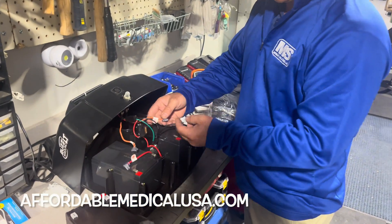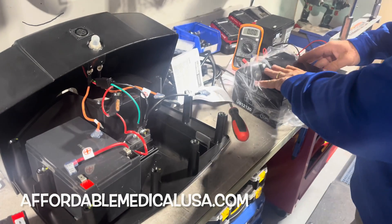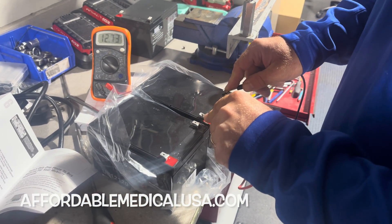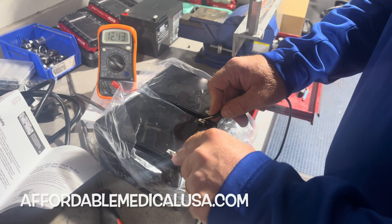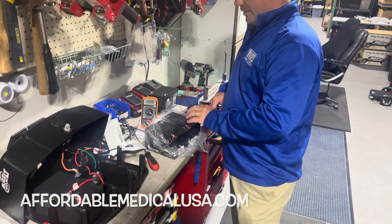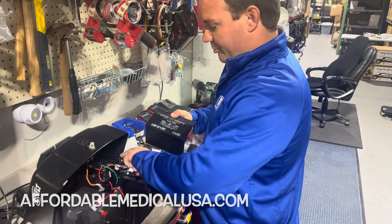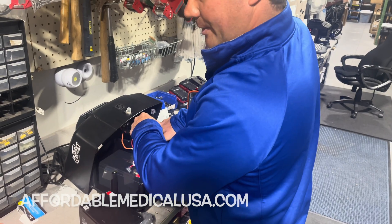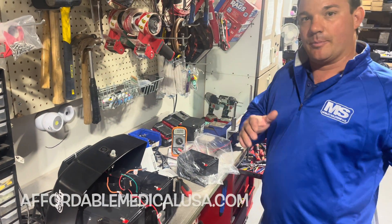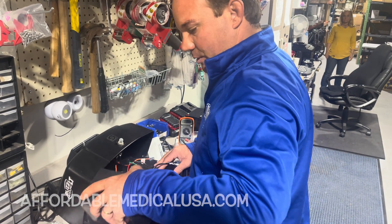Just disconnecting the cords — everything's pretty much labeled — and pulling it out. When you get a new set of batteries, what we like to do is check the readings on them. We're at 12.73 on one and 12.72 on the other, so we want to be within a couple decimals of each other. You don't want to put in something really off, like 12.50 on one. If you buy something online from Amazon or wherever, make sure you're checking those batteries before you put them in. If you get something below 12, they might already be bad — call them back immediately. If one reads 12.5 and the other is significantly lower, you probably want to exchange it.